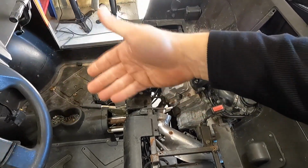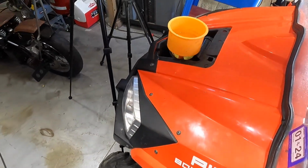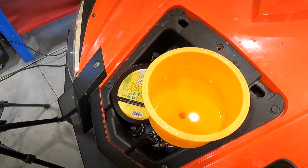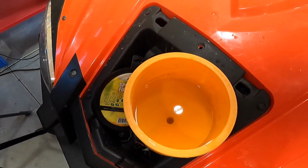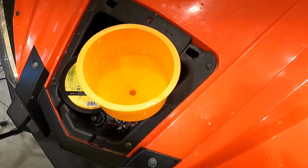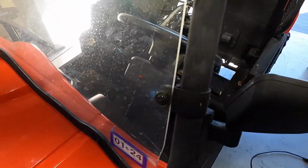I mean, like I said, I've spent up to 45 minutes, but it was just a bubble here and there, not a constant bubbling like that when you start the unit. So I'm going to say we might have a blown head gasket. The coolant is still really cold. The radiator is only 130 degrees with my heat gun, but we're going to go ahead and pull a spark plug.